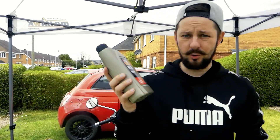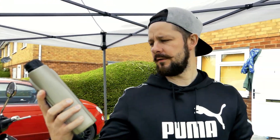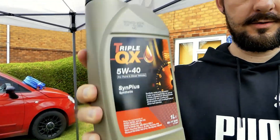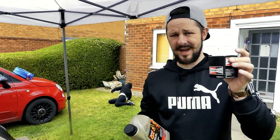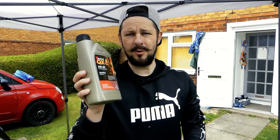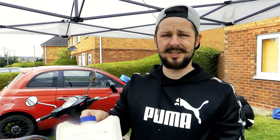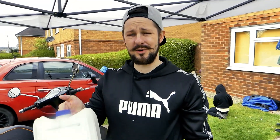We're using a fully synthetic oil for my scooter — 5w40, very good oil — and a specific oil filter for my GTS 300. We're going to need 1.3 litres of oil. The old oil goes into this container, then we take it to local authorities to get rid of it the proper way. Don't just dump it on the grass or in the drain — keep the planet green.